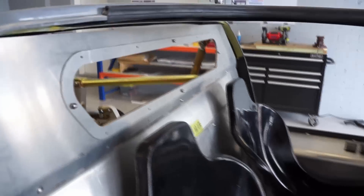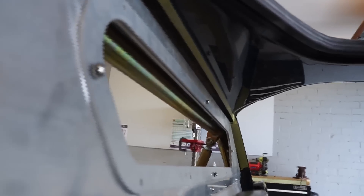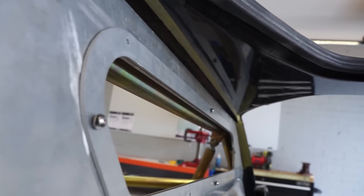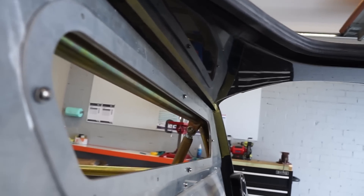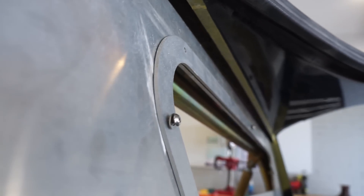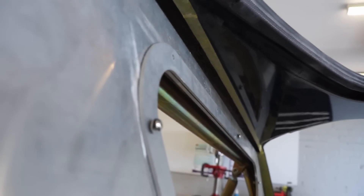This is how the spider now looks after that first section has been trimmed — you can see it's probably about half an inch away from the actual headwall aluminium panel. I'm hoping that when the top comes down it'll sort of rotate and push back as it rotates down, because I do have it bolted in with the temporary fixings at the front. Now I'm going to very carefully start to trim back the sides — I'm only going to go to the extent of the existing roll bar cutout for now, just so I can start to get this top section sitting down over the panel, taking smaller sections at a time.